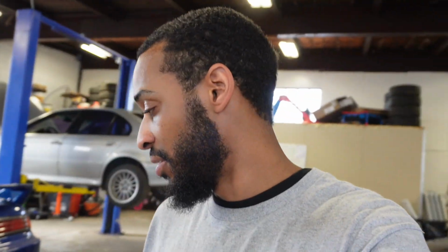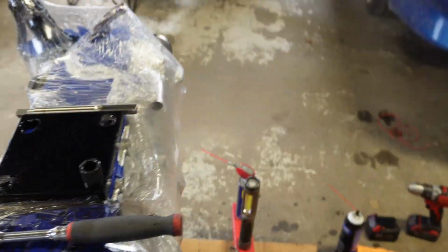Okay, literally finished step 2 just now, which is about 3 hours later, and that's from simply drilling in this hole. That was very tedious, extremely tedious. We could only go very little bit at a time, probably about 3 millimeters at a time, or like 1/8 inch at a time. Back it out, clean the drill bit, clean all the metal chips out of the hole, clean the WD out, put WD back in, drill it. It took a lot. So we got the first step done, which was the drill.